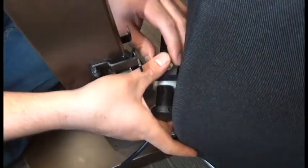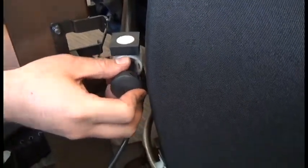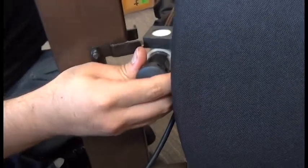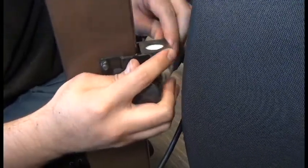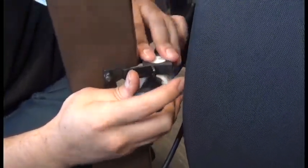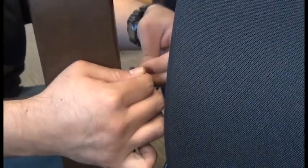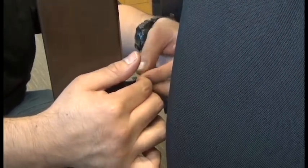Okay, we're ready to place those black rubber spacers onto either side of the new actuator. And then insert those spacers into the open bracket, turning the spacers as necessary until it is flush with the outside of the bracket. Once the spacers are aligned properly, we can replace one of the horizontal metal brackets and install 2 of the Allen screws and hand tighten them to secure it.